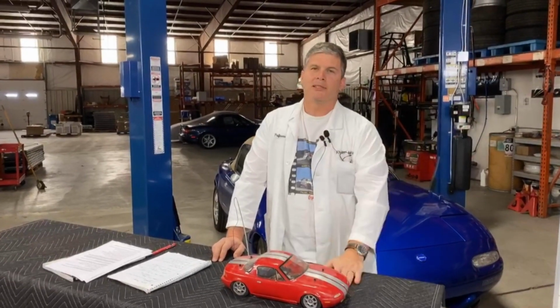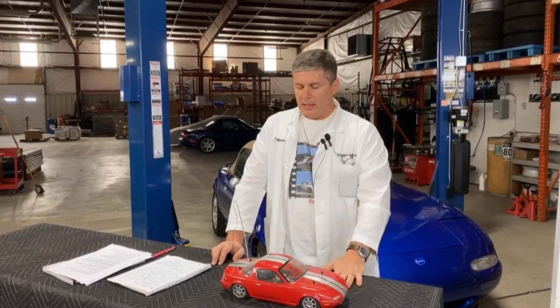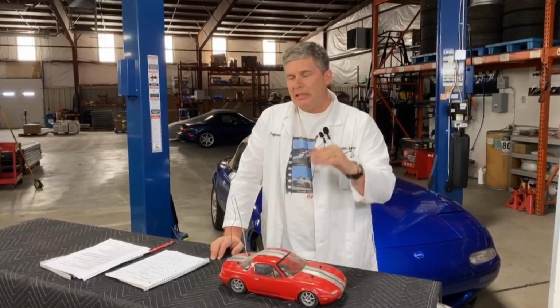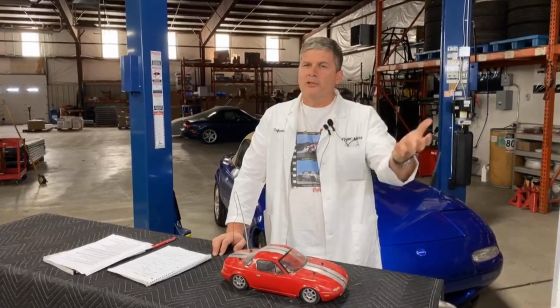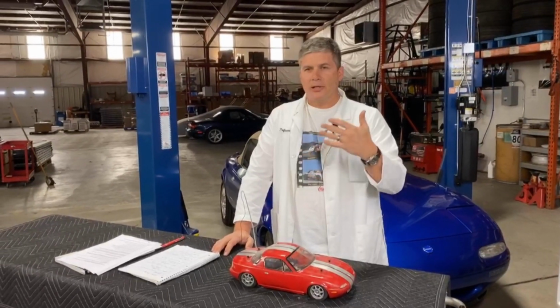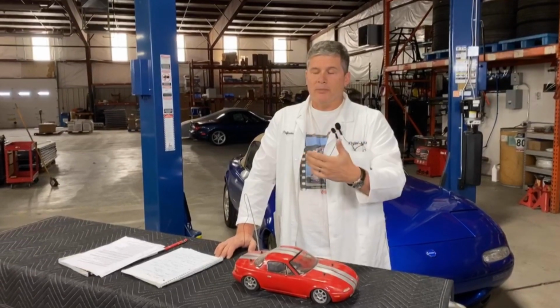You want a brake pad that does the same. If you're driving in sub-freezing temperatures, for example, that's very important. Pads like the Porterfield R4S, or some of the Hawk pads, can certainly deal with everyday driving, but that first cold stop might be a little slippery, might not feel completely solid, especially in cold weather. You have to decide what else you're going to use the car for. If you're autocrossing or doing light track days on the weekends, then something like the R4S or the HP Plus might be a good choice. But you have to be aware that it will be weaker in very cold temperatures and when the brakes are cold.